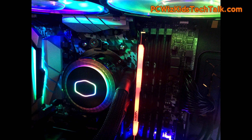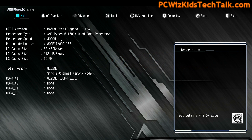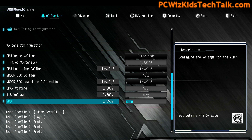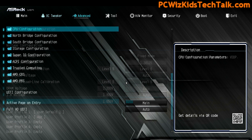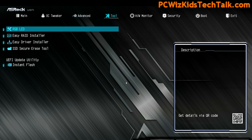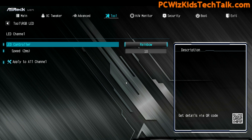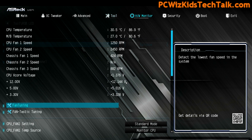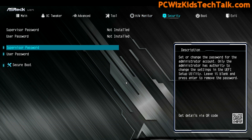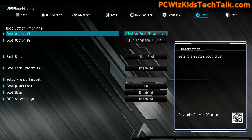You can control some lighting effects through the UEFI BIOS or through the software. In the BIOS, the Ryzen 5 1500x has been overclocked to 4 GHz — I set the frequency to 4000 MHz, left most things on auto, increased the voltage to 1.381V, set load line calibration to its highest level (Level 5), and disabled Cool and Quiet to prevent throttling. It's consistently running at 4 GHz at 1.381 volts — not 1.45V like other reviewers were using.